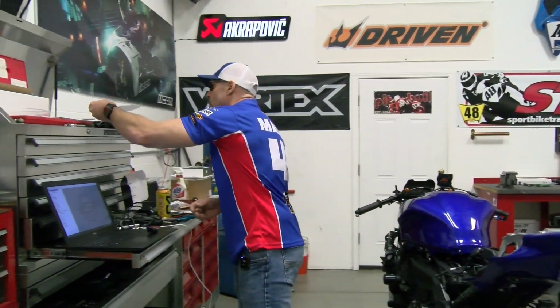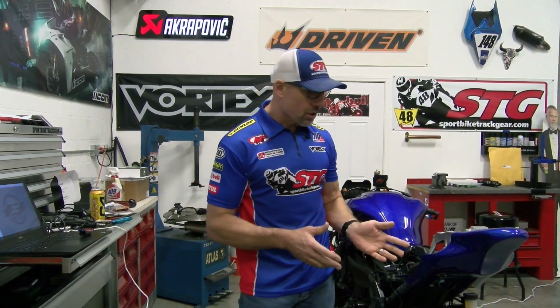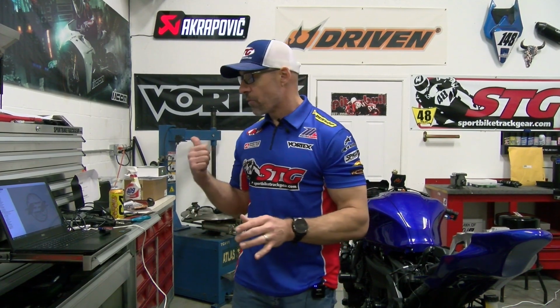So yesterday, when I did that hardware test, I got mixed results. One time, and then after that, every time the fuel pump would cycle, which would normally indicate that I misinstalled something. Fair enough. So I went through everything, found nothing, spent a bunch of time on it, pulled all the pins out, made sure that they were properly crimped, and so on and so forth. It's kind of a long tail we're weaving here. Put everything back together, got back on the phone with tech support after I spent some time with this test.